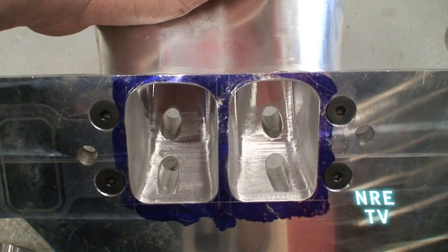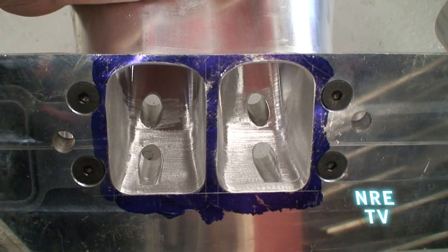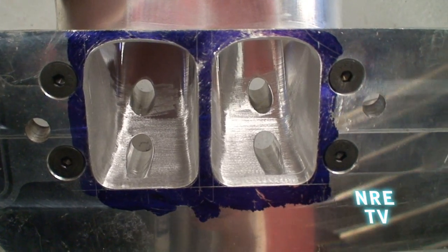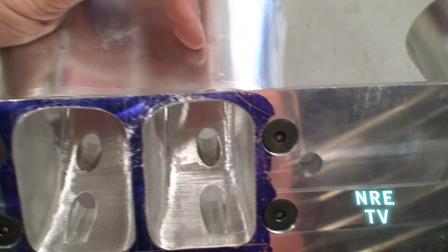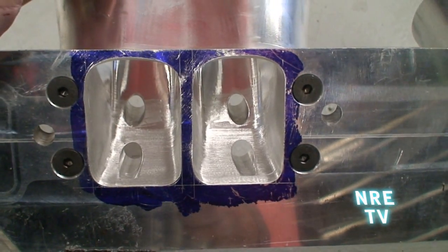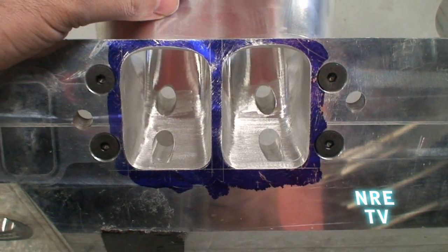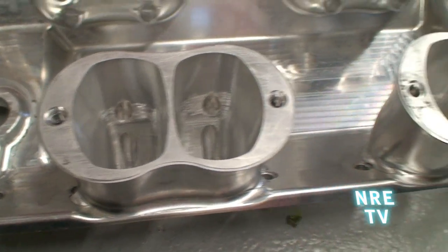If you look at the runner, you can see the injector placement. This is a dual injector setup — we've actually ported this out for a pretty heavy-duty one of our Warrior series builds. The injector itself is a straight shot at the back of the valve, which really helps fuel consumption and everything in general. Rather than shooting it straight at the floor of the port like you normally would in this part of the runner, we inject from the other side and both injectors shoot straight at the back of the valve. That's allowed us to not use as much pulse width and we got more horsepower out of it. These runners are also individual — each runner bolts on to the base itself.